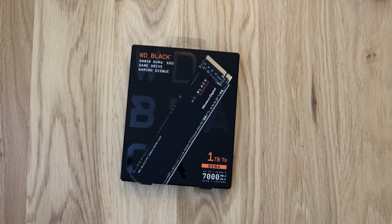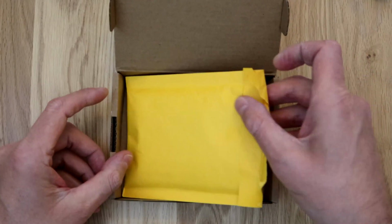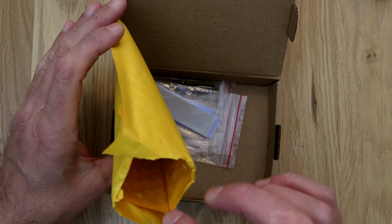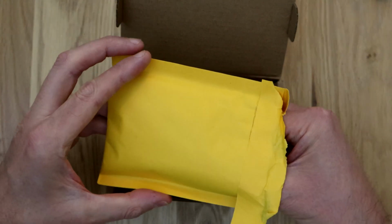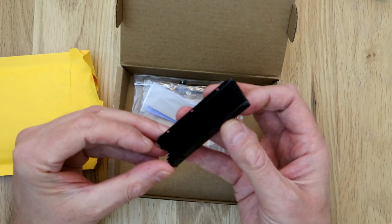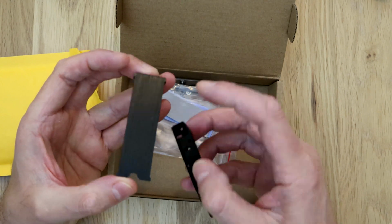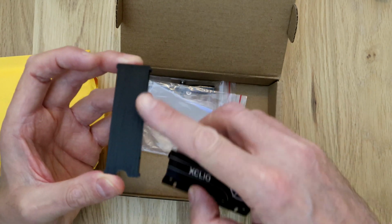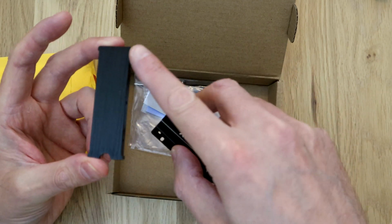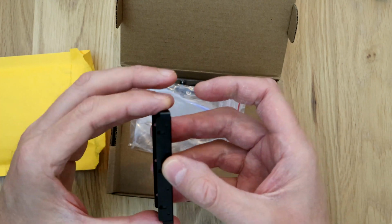And first things first, let's have a look at the heatsink. So this is the heatsink I got. It's a non-branded thing. I'll put up the one I got in the description so you can have a look at that. And a lot of people have used similar ones. I don't know if you can see this. It's a 2-part one, double-sided. And what you would do, you put the thermal paste on here and thermal pad on here and thermal pad here. And then it goes together and it only goes one way.